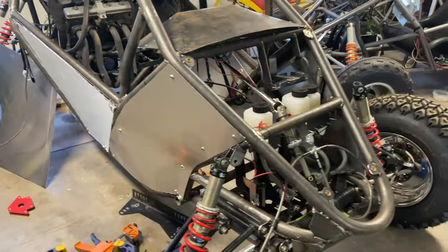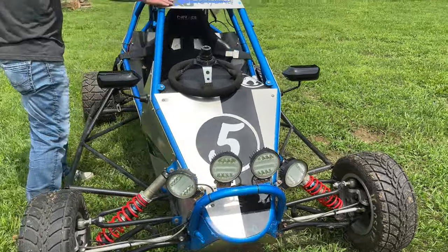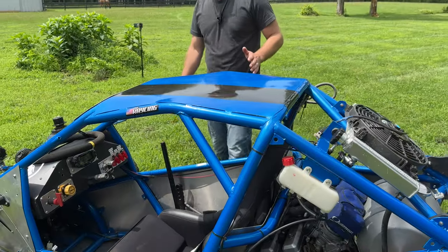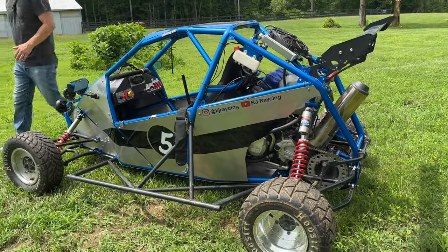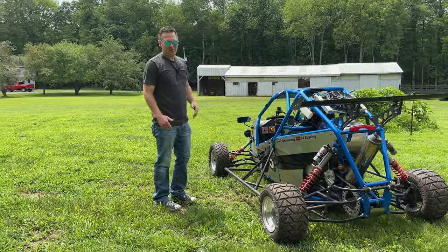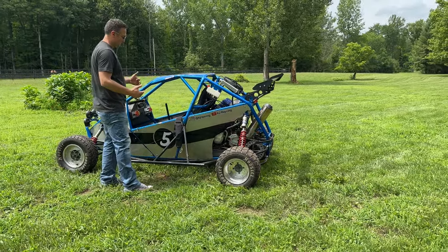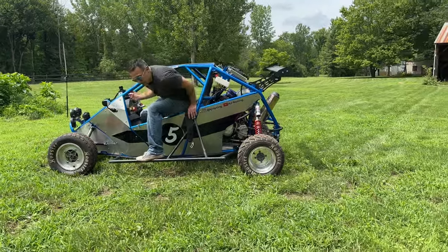I put a little eyebrow on the front just because it looks cool. I have a one-millimeter-thick roof that is welded on in 20 places as the rules state. Now, about the size — this looks incredibly small, I agree. I'm 5'11" — right at that normal guy mark. The racing seats sit pretty low; there's no forward-and-aft adjustment, but if you put sliders in there it'll raise it up two inches. There's plenty of room and they're not too hard to get in and out of.